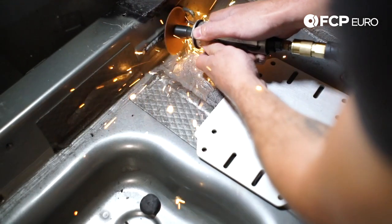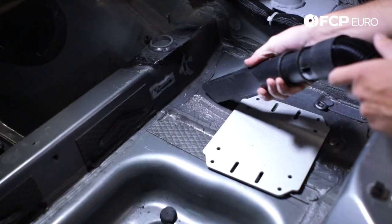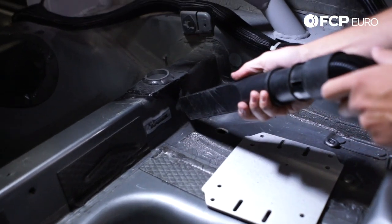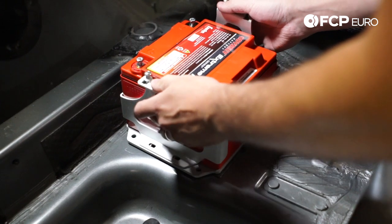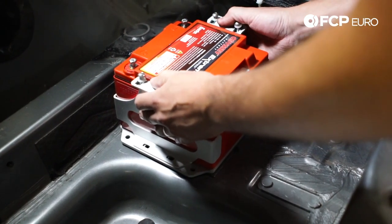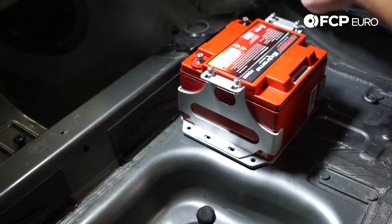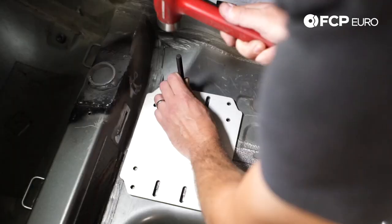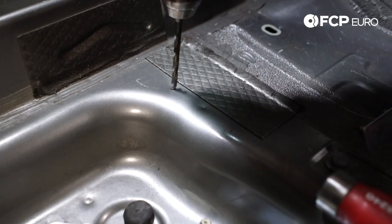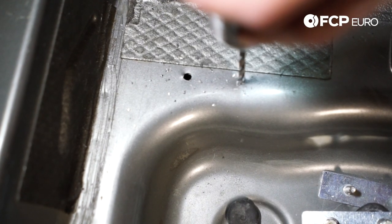You may have to move some stuff around, possibly cut some things out like we did here. On a show car, you're probably going to cut some carpet or at least slot it to get the cables in. The last thing you really want to make sure is before you do any drilling or cutting, you've tested everything and made sure that the kit fits in there. Right now we're test fitting the battery — making sure we have good clearance all the way around. We have our positive cable here, our ground right here, and we're good to go. It is best when drilling your car to use a simple punch to start any of the holes — this will keep the drill from dancing around and ruining the paint. After the holes are drilled, use the hardware in the kit to bolt down the bracket. Remember, it is important to measure twice and drill once.